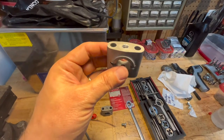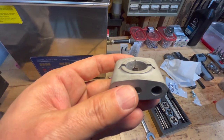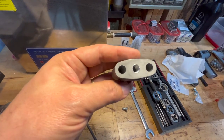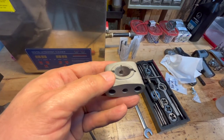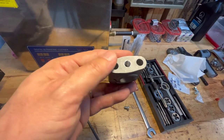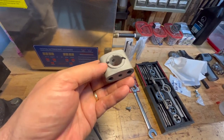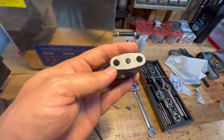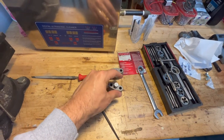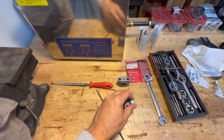Let's take a look at one of the stands we got done — I've got both of them done. Went ahead and tapped it and cut that little channel in there. Want to double check and make sure I don't have any burrs. The idea for that channel is just so there's kind of a weep hole — air doesn't get trapped inside that shaft — and we can certainly double check that when we prime our oil pump before we start up the engine. Pretty much ready to go with these two stands. Now we're going to take these bolts and take off the first thread or two so we can use the bolt to center the shafts on the stands.